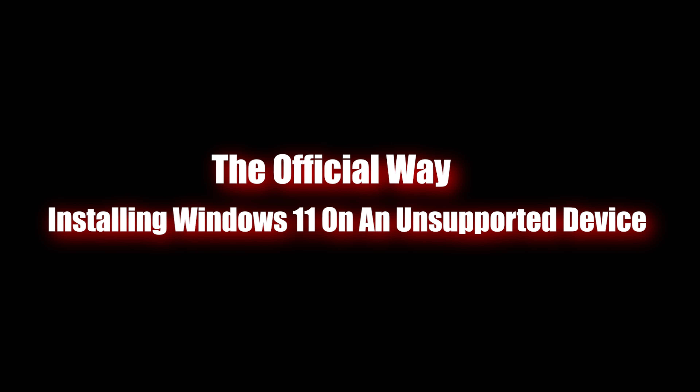You can create a Windows 11 installation media — what you need is basically a USB pen drive or a DVD. I'll link the Microsoft official website where you can create a Windows 11 installation media. Just plug it into the system and press Escape, F2, F10, or F12 — depending on the manufacturer of the computer or the motherboard — choose the boot device as the pen drive, and then wait as a fresh installation of Windows 11 is done.